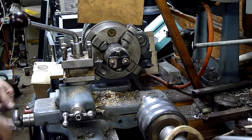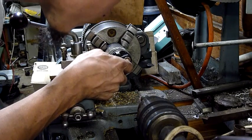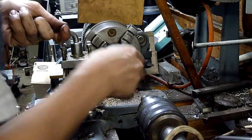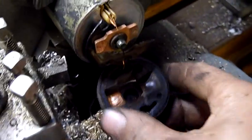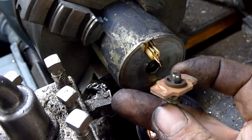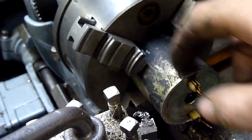I think that got it — I see, it's actually welded to the casing as well on the negative side. I think I just lost the contact spring. Okay, well that's the main contact assembly — they have exchanged a bit of material but they're not dead. The starter contact is definitely very pitted. The little solenoid contact, and the rest of that — there's the solenoid coil, that's just a copper coil inside there, so no real point in cutting that open.